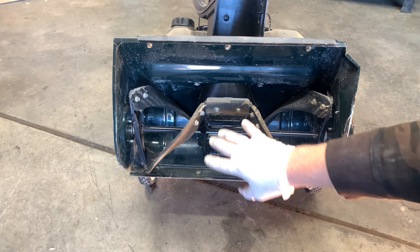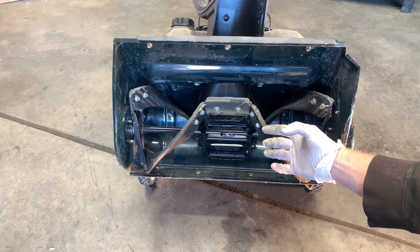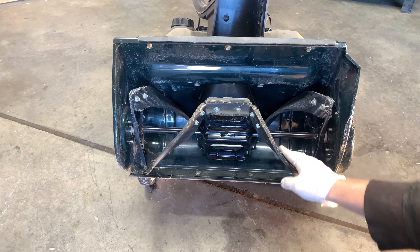The impeller looks good. When it gets really worn down, you can see these bolts on it — you can take it off and put new rubber pieces on there. This snowblower is ready to go for winter. It was a huge help that the gas was drained before it sat, otherwise we would have been pulling that carburetor apart, cleaning it, and possibly even replacing it. So just changing the spark plug, adding some new gas, checking the belt, checking the auger, checking the cable — just basic checks. Simple service and it's ready to go.